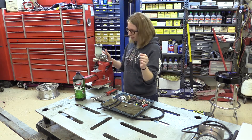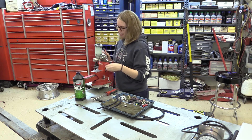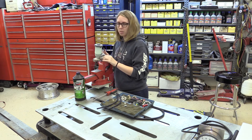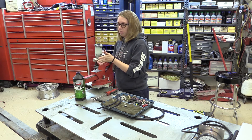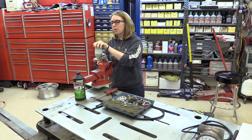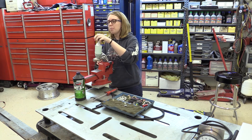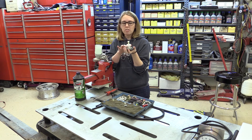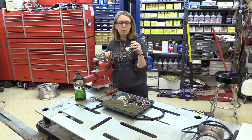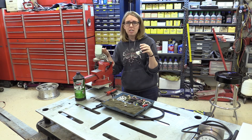The adapter is right here. We have two of them and the threads are just a little bit under, which is perfectly fine. We don't want them to be over because we don't want to ruin the threads. We just want to get it nice and tight so that way it sits perfectly on the seat. We're going to go ahead and take off our reservoir cap. On this particular one, as you can see, we have a little float mechanism. This is wired into a series circuit which causes your brake light to come on on your dash when you have low brake fluid.